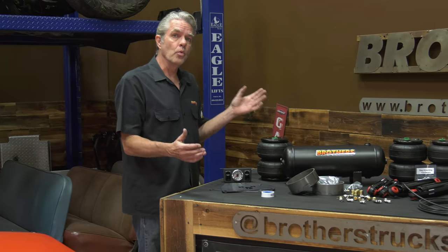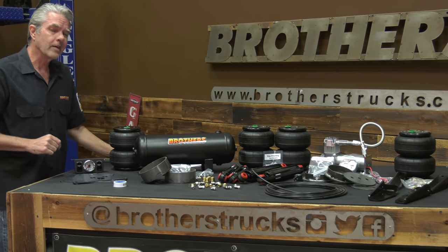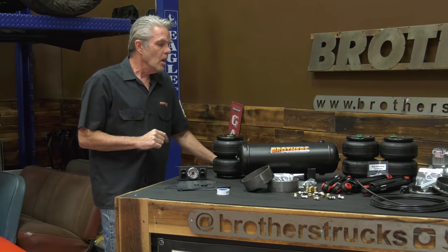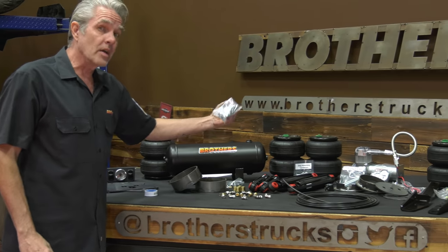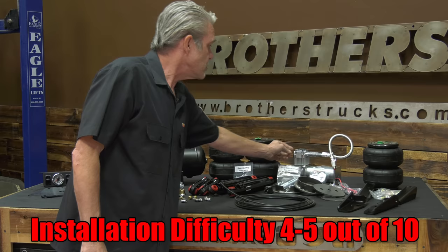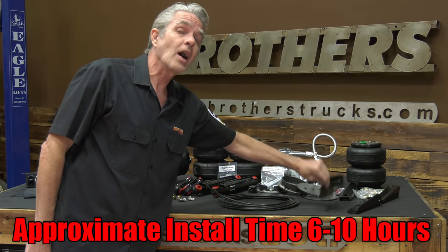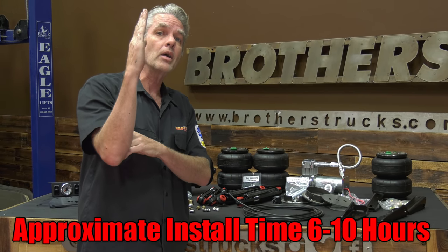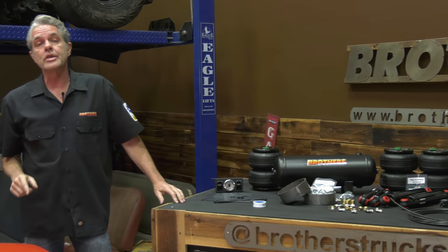We're looking at everything that's going to be coming with your kit. We've got the instructions, all the plates, the fittings, etc. The only thing we're not going to have is the wiring — I'll show you how much to get and how to install that a little bit later. We've got our airbags, our tank, our brackets, nuts and bolts, our fittings — these are quarter inch lines. We're getting a ViAir pump, a very popular pump for airbags. We're also getting a shock relocator kit because when we bring it down, we're going to have to take that shock from an excessive lean and get it back up to a more acceptable level.